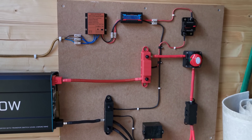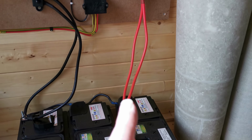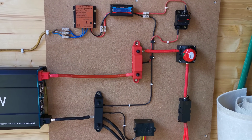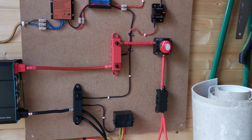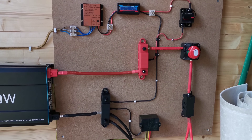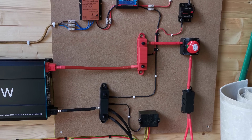It's not particularly neat but I tried to get it as symmetrical as possible. I pre-bought the leads pre-crimped and heat-shrunk with the correct rating. The twin positives and twin negatives from the battery came with the Renogy inverter, rated at 100 amps each so capable of transferring 200 amps. There's nothing I believe I'm going to run next door that will take 200 amps, but you never know. I am going to supplement it with a 100 watt solar kit and I've also bought a separate solar charger — I didn't want to put all my eggs in one basket. Renogy and Victron do chargers that can do both wind and solar, but I've kept them separate.